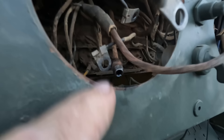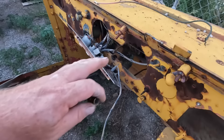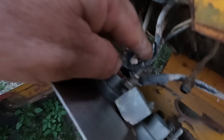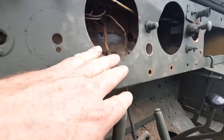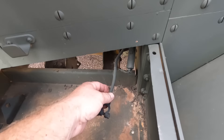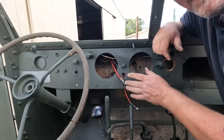That oil pressure line is a flare fitting, and this Jeep oil pressure gauge is a pipe thread fitting, so I need an adapter. Luckily, whoever hacked up the dash on the parts half-track had the same issue, and I found the adapter right here going between a flare and a pipe thread. The wiring on the parts half-track isn't as bad, but the same issue — the big high-power cables have insulation just flaking off. I pulled all the damaged wire out of the dashboard, which left me a lot more room to work. I'm just going to put new wire for everything I'm using.